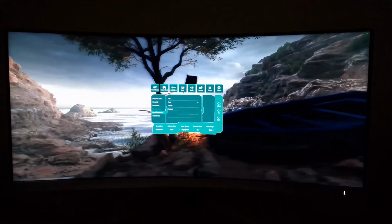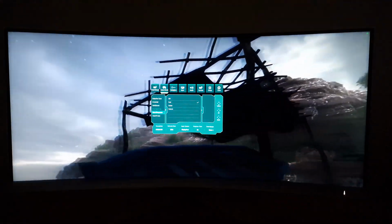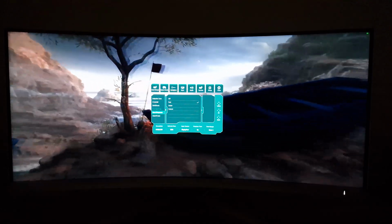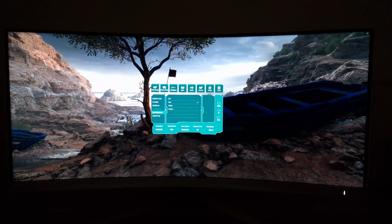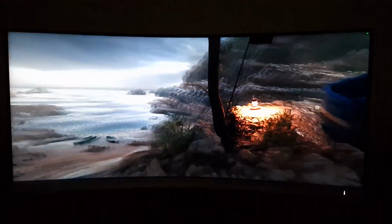Perhaps it's reduced a bit for this transition, but just observing more broadly, there are definitely some instances where overshoot's really just as obvious with faster and fast, in my view. So I've now set it to off, which completely eliminates the overshoot, but also the smeary trailing is now extreme. It's just horrible, a huge amount of additional perceived blur. So back to 165 Hz and my preferred faster setting now.